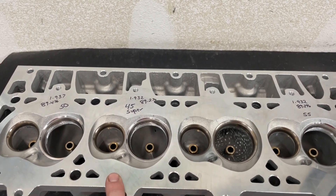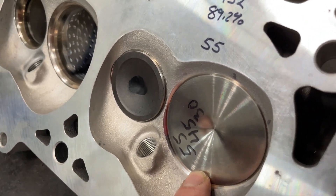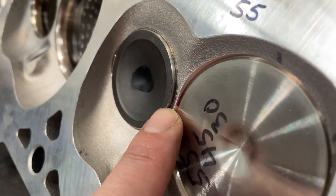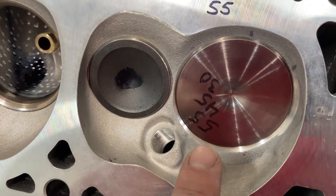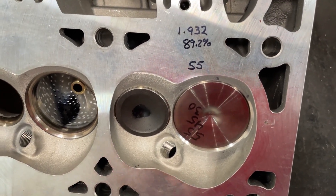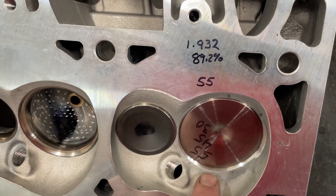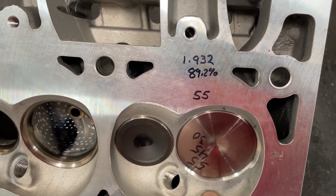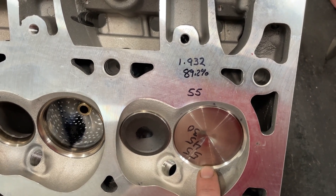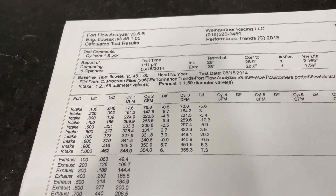I'm going to flow these and show you the results. The 45 will be flowed with both valves - the one we use for this test and the Freya. One quick thing before I flow: this is the 55-degree valve job - you can see how much I had to drop it down to get the top cut to come in, and look how low it sits compared to where the exhaust valve is. It's way sunk in. This is the reason why you typically wouldn't use it on this head, but this is just for experiments. The top cut is actually pretty important for flow, so it wouldn't be fair to compare the 55 if I didn't have the full top cut come in.